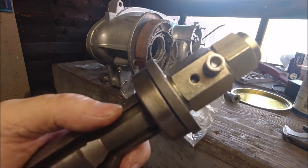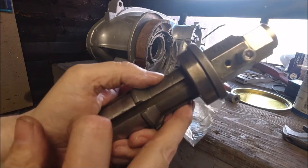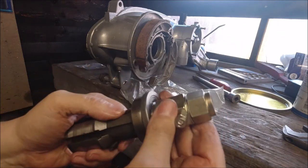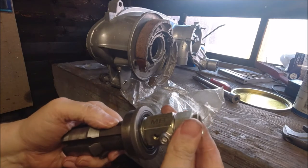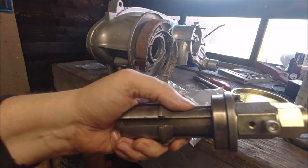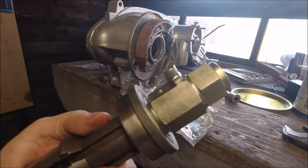You've got two holes in there — that one's if the lay shaft is in, so you can line it on the spline. It just stops it turning because you can hold that with a spanner, so you've got two points of locking off the lay shaft to pull it through. Brilliant tool, worth its weight in gold in my opinion.